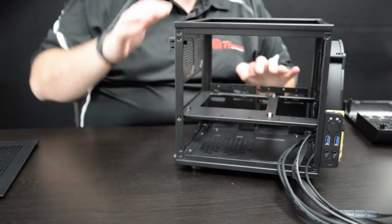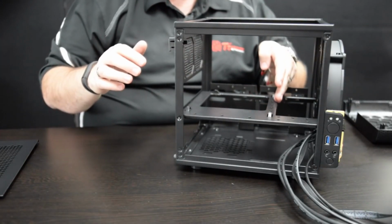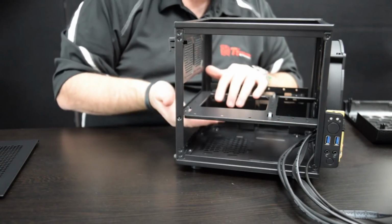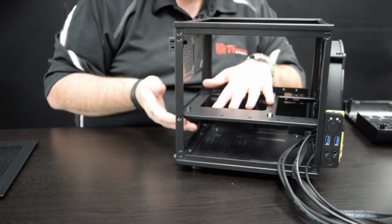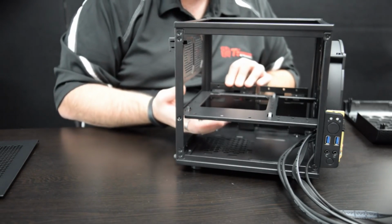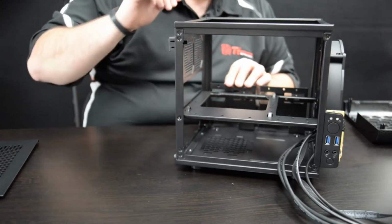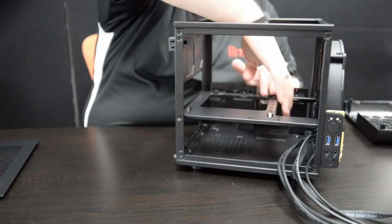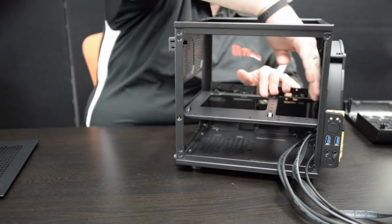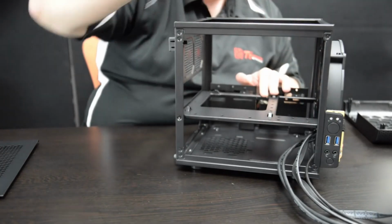Okay, now inside the chassis, you can see it's actually quite spacious because your Mini ITX board and mounting all end about here. You've got a very large CPU tray cutout. Obviously, once the power supply is mounted down below, it's going to block this area, but during initial assembly, you can swap coolers or put the cooler on with the motherboard installed, which can make it much easier depending on your type of cooler. Now, speaking of cooling space, you have a very large area right up here behind the 200mm fan where radiators can populate, or you can run your cabling or even tubing, tube reservoirs, what have you.